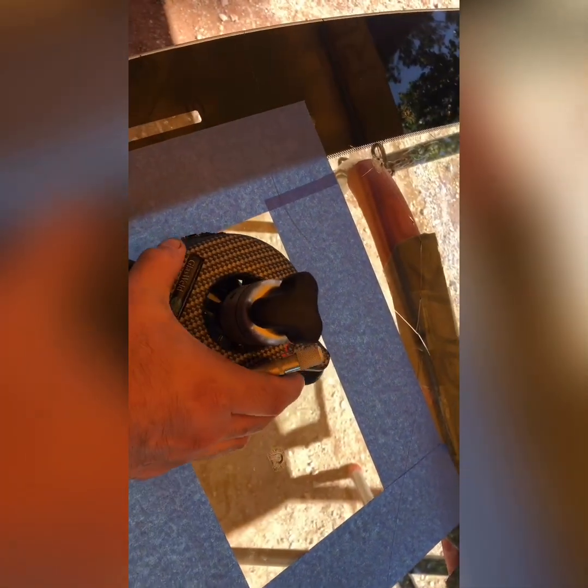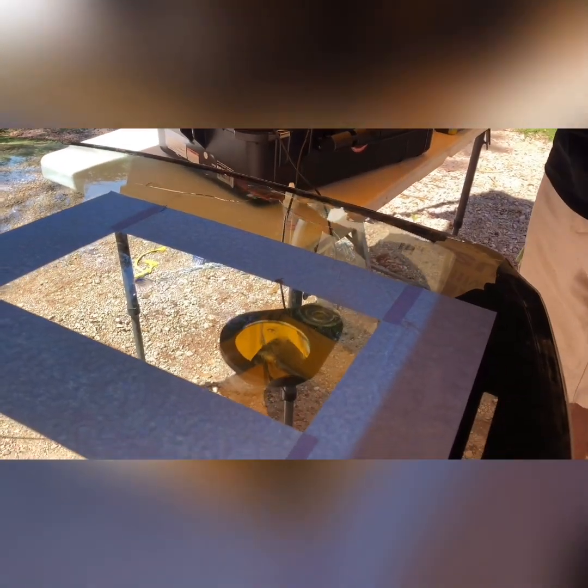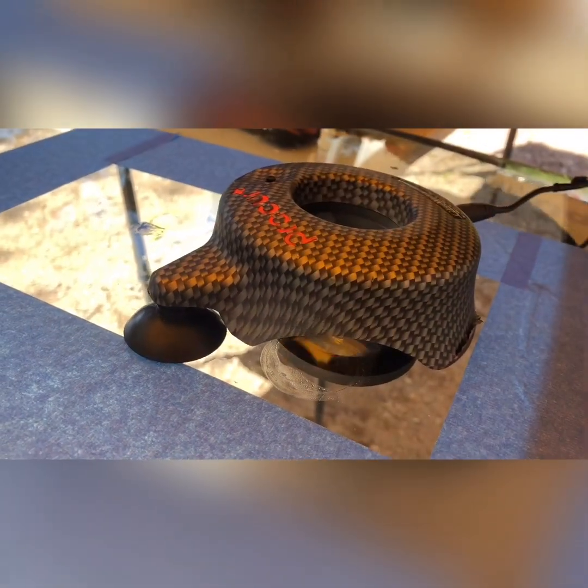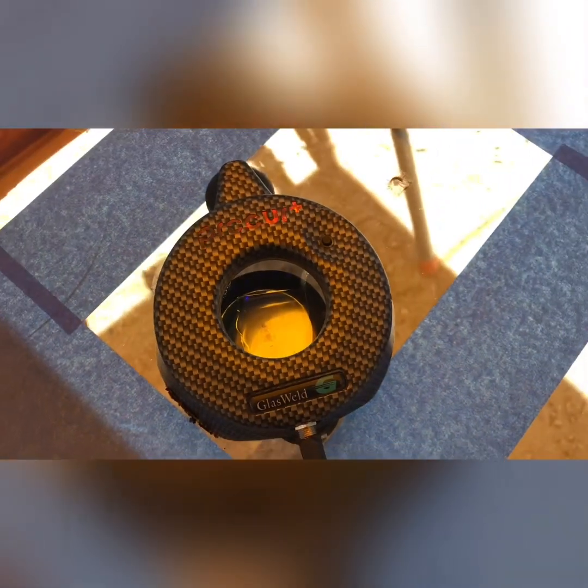Alright, so I'm gonna go ahead and take the light off. It stopped blinking. I think I may have missed that one right there, maybe. A little darkness. Use a pit filler, seal the surface, put our light back on. Go ahead and remove the mirror. That's a pretty big rock chip.